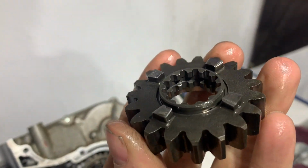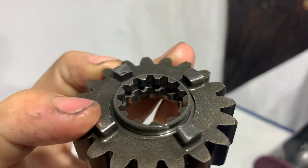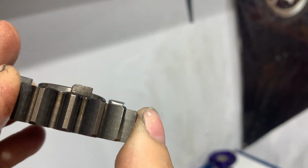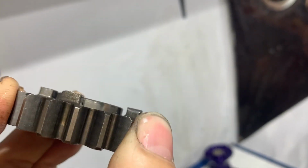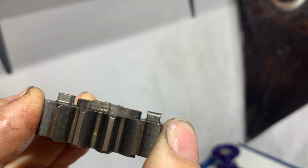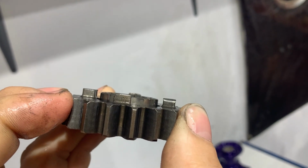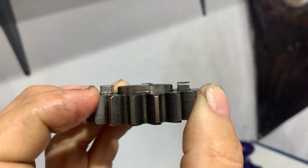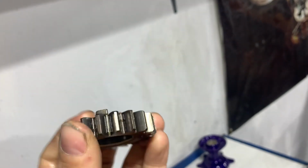That's because on this gear, I don't know if you can see it or not, but the dogs back here, they're rounded, just ever so slightly. And when they get like that, then when this gear and the gear below it go together and get pressure on them, they put a lot of out pressure because they're not hooked solid, they've got angles. It squished that washer and allowed this gear to push up and slip over those cogs. That's what had it missing fourth.